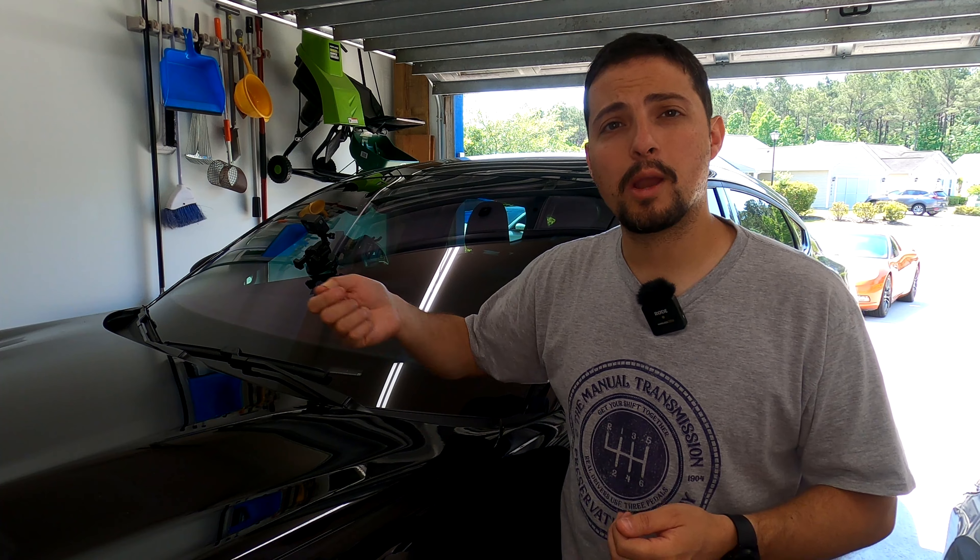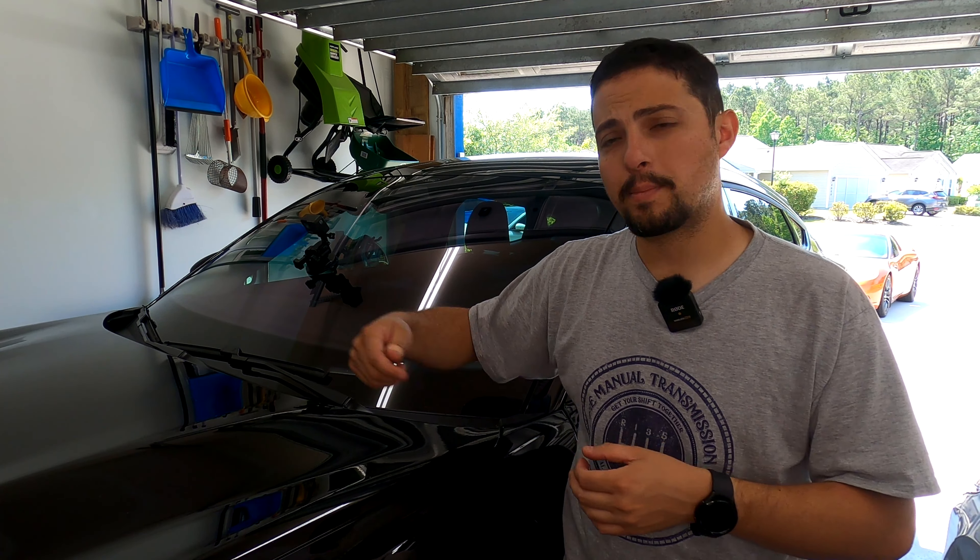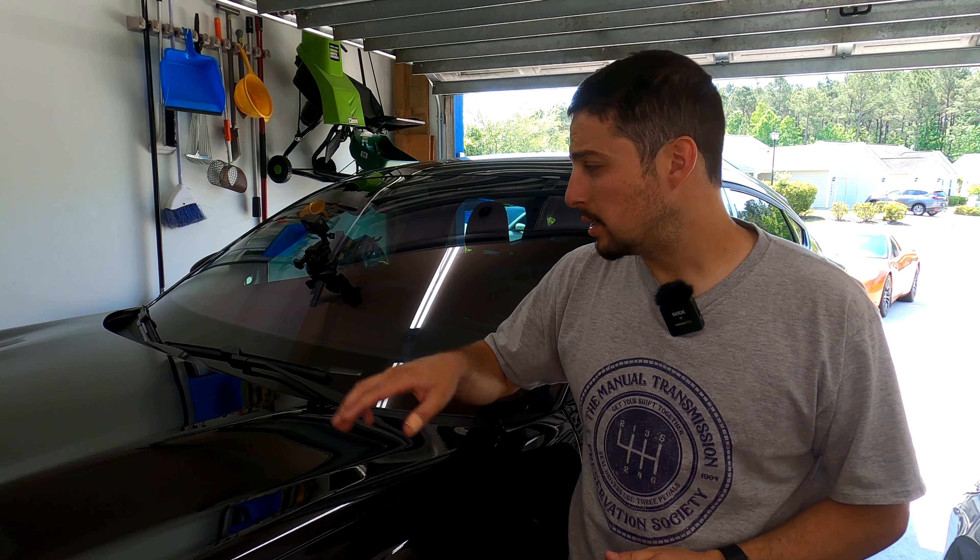And that's all there is to it — one button to release the wiper blade from the wiper arm assembly, pull it out, get your adapters, put the new adapter on, and you are set to go. I actually really like this style wiper blade much better than the old J-hook style or any other ones I've seen out there. I'm kind of glad that Ford is adopting this method, especially on the Mustang Mach-E.